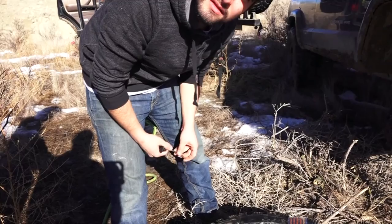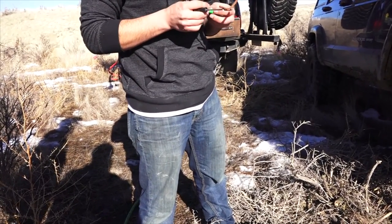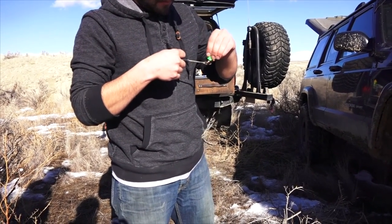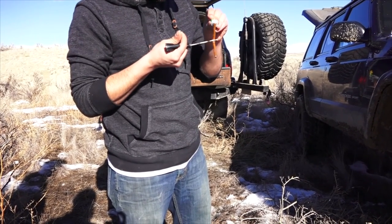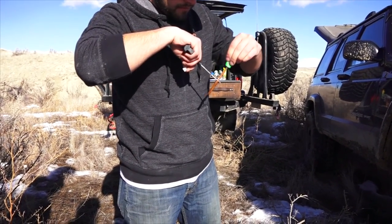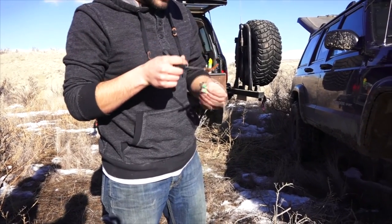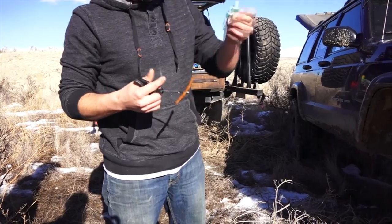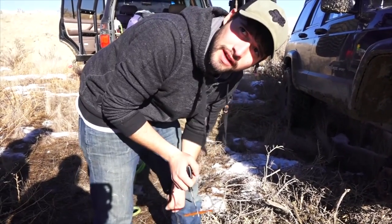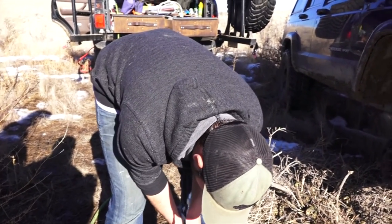You just stick it in? No. Put a lot of rubber cement on it. On this? Yes. That should be good. It's going to be on the top anyway. Now just take it. Right. Go in all the way and then come back out, right? Right. Well, not all the way. Just leave little tails and then with the jerking motion pull it out.